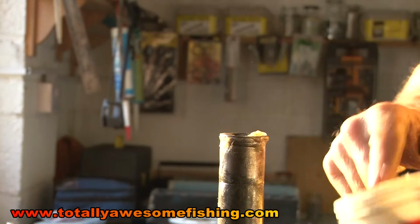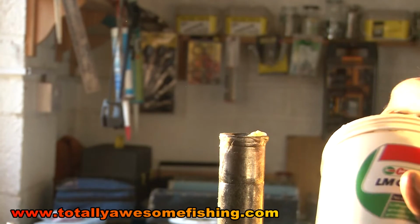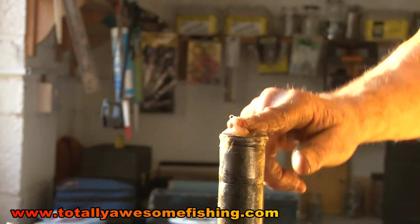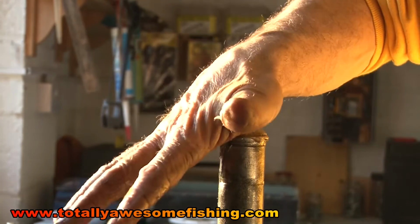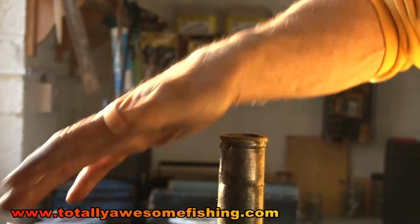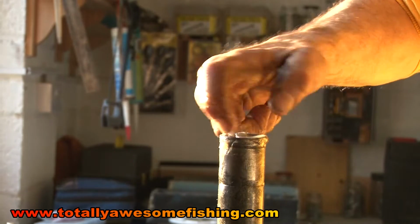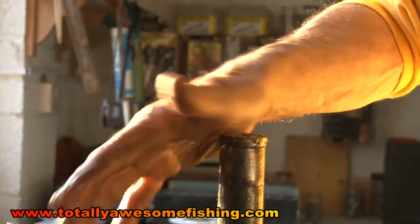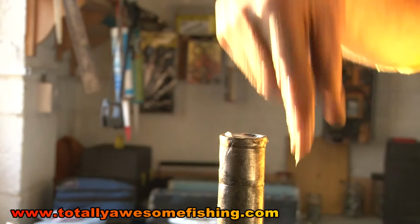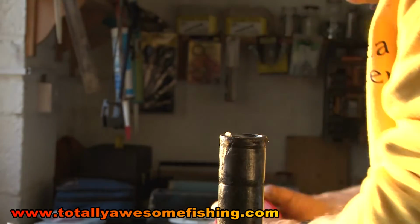Right, down the centre here, I'm going to get some of this grease that I use on the bearings. I'm going to gob it right down the thread. So I want it to go right down. I get my palm on my hand here and I push it down, because the air can come out the other end. So I can force down a good whack of grease down that centre core across the thread. Bang, it bursts down. And then when I re-screw it, it's going to push that grease right down the centre of that shaft. So we're nearly done.